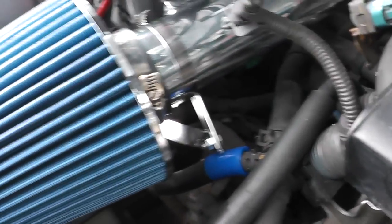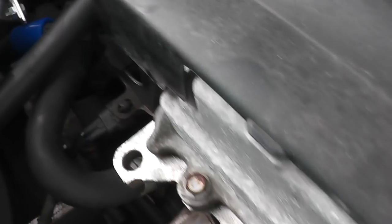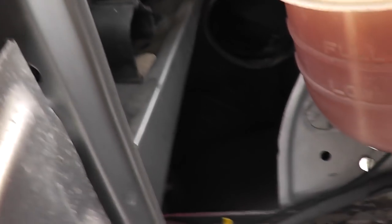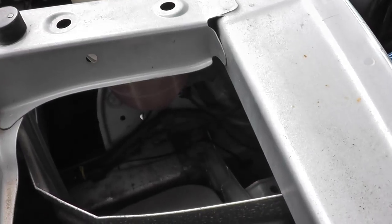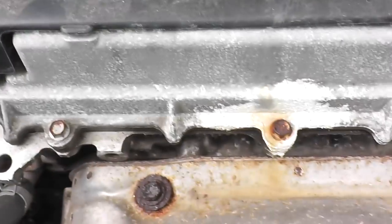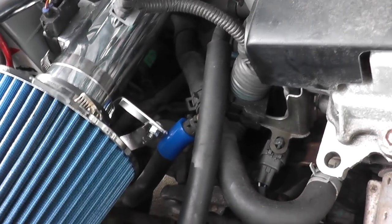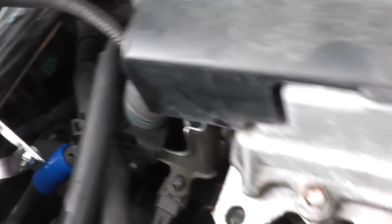So that's how we're looking now. Yes, there's going to be a certain level of heat soak from the manifold to this side. I am going to make a heat shield which I'll bring down and around. The intake that comes around — I'm going to extend that round to the filter so it's bathed in cool air being brought in from the side of the car. I'll heat shield this, though I'm not racing this car — it's a stock engine. I've got the stainless exhaust to go on it but nothing else.